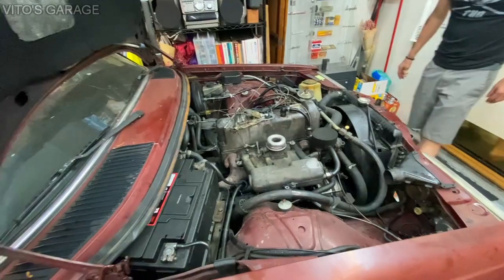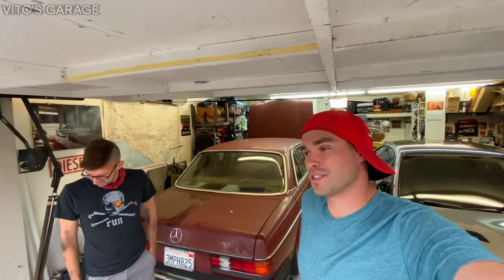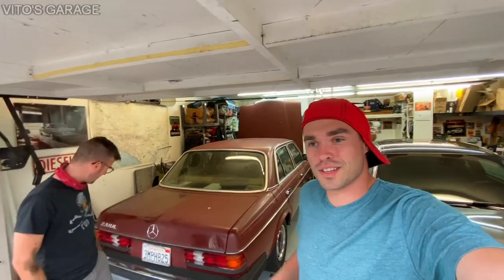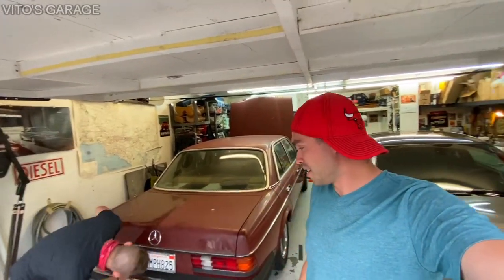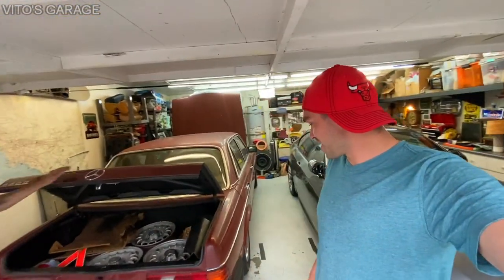I appreciate you, John. Cool stuff. You'll just get the bolts and other stuff and this car will be all buttoned up and happy. So that's gonna be it for this video. I hope you enjoyed what we did with Sean today. We had so much fun fixing this 240D. We got the trunk opened up, discovered a lot of goodies inside, tightened the alternator belt, and discovered a loose starter motor — that's gonna get fixed. He's waiting on a couple of bolts. He replaced the power steering hose and topped off the power steering fluid. Anyway, hope you enjoyed this video — don't forget to save classic cars. Peace.